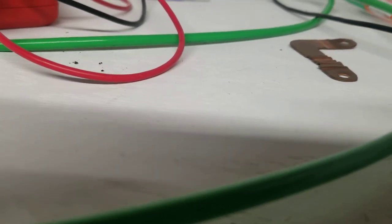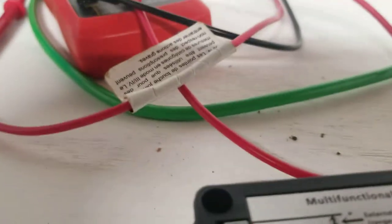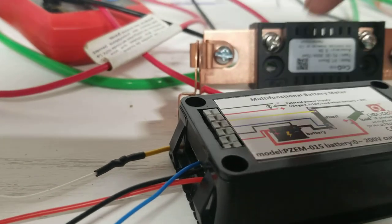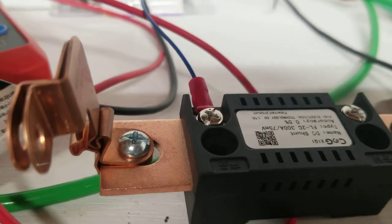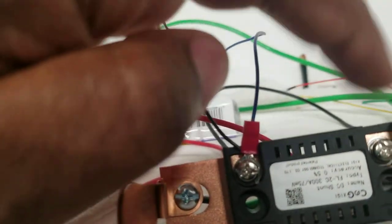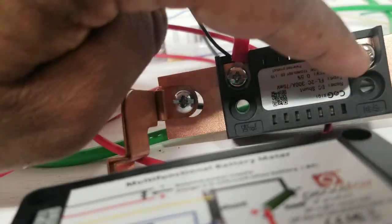You can see these things working. The blue wire goes to the shunt — on the positive side of the shunt near the negative of the battery. The blue goes right here on the shunt. I'm also putting the negative connection there. Then the yellow wire goes on the next terminal on the shunt.